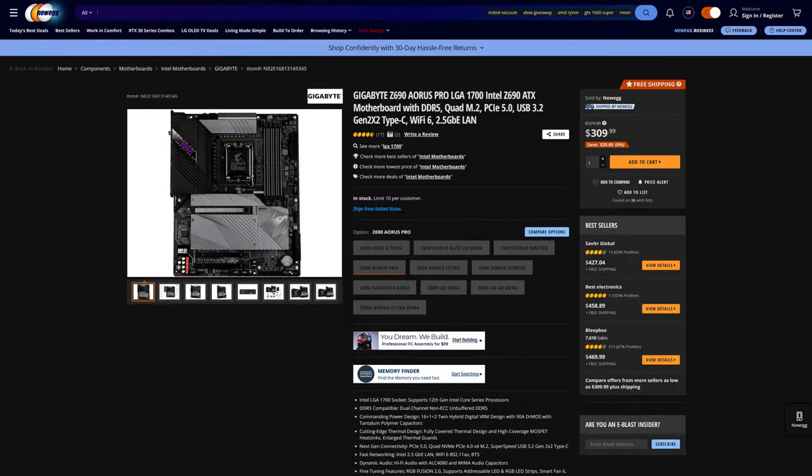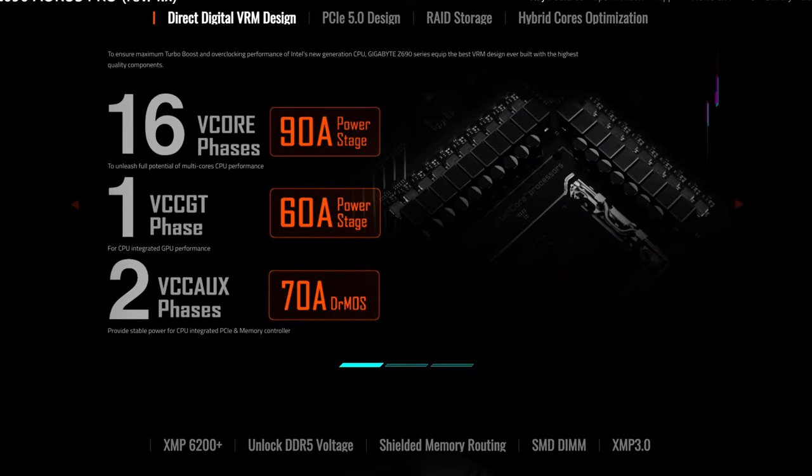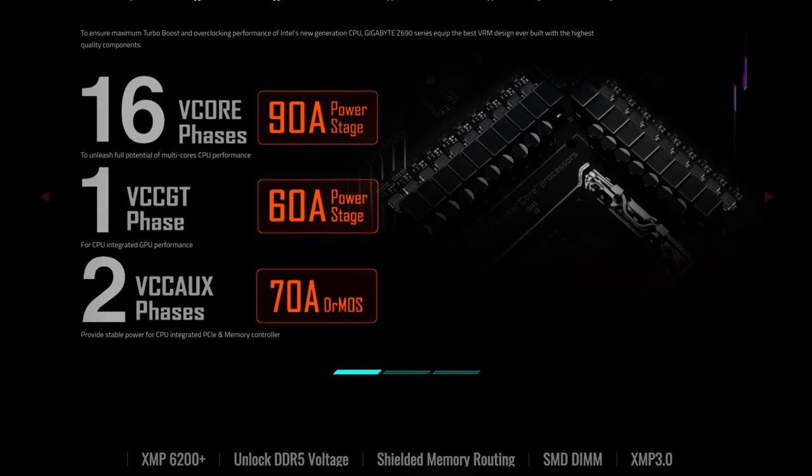And that's nothing compared to the Aorus Pro board. That board passes the $300 mark so it may not be for everyone, but it has 16+1+2 power phases rated at 90 amps. So if you're all about giving your CPU the cleanest, best power possible, that'll probably be the better board for you. If not, even this TUF board should be able to support an overclocked 12900K — though that comes with a massive asterisk. Most people who use their PCs normally won't see any difference between these VRM designs. Overall, the power delivery is fine, but unimpressive.